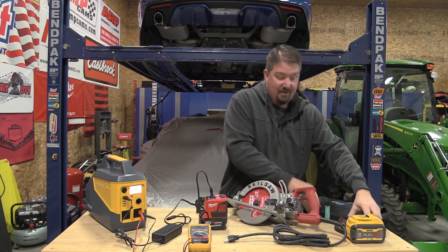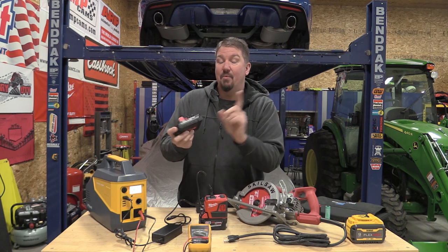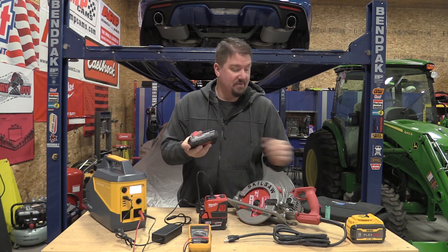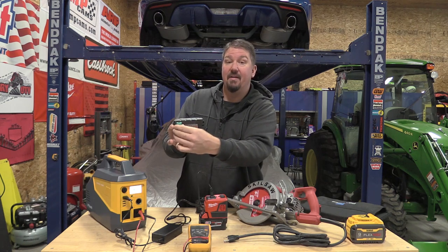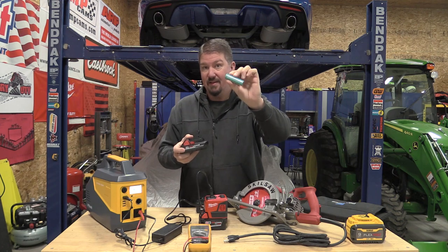If we take a look at this 18-volt battery pack, it's a 1P battery pack, so it's got one set of five cells in the bottom. You're just lining all these along the bottom, wiring them together, coming out to 18 volts because these cells are 3.7 volts apiece.